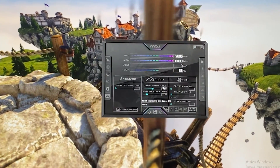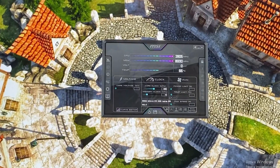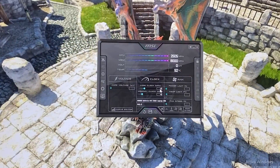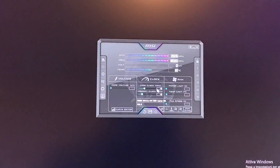What about 400 — would 400 work? Let's try. As you can see, it froze and crashed, and you might be panicking: 'Oh my god, I broke my PC!' But no, just hit the reset button and wait. Maybe Heaven Benchmark will start working again, or maybe you'll have to open it up again, but it's not an issue. As you can see, it's now working again. Now you want to remember the limit you reached, which was 300.